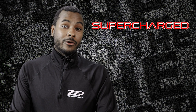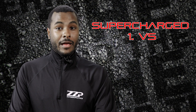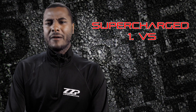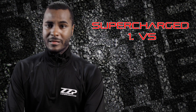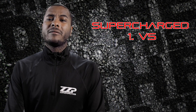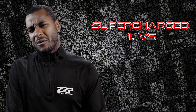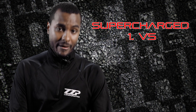For supercharged guys, here are your cam selections. The first cam we offer is called our VS cam — VS stands for valve train safe. This is actually an emissions-friendly cam. If you want something for a nice street cruiser that doesn't sound crazy, drives nice, and can still pass emissions, this is the cam for you. It only requires 90-pound valve springs. It's the one you'll want if you're looking for a very mild build, bolt-ons, or your first step up from 1.9 rockers.